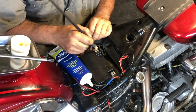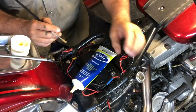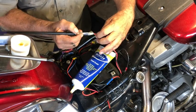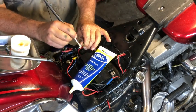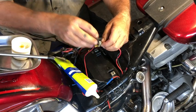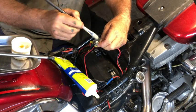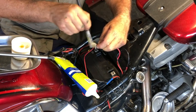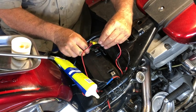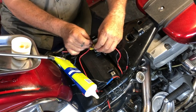The next thing you should do, whether it's a truck or a bike, is get some lanolin — either the oil or the grease — or something like it. Lanotex is the best. Coat the terminals, coat every part of it. This is going to stop corrosion, and trust me, it'll last for the life of the battery. Having everything nice and slippery when it goes together means you're not going to break anything, which is crucial with motorbike batteries.